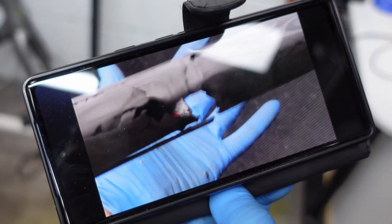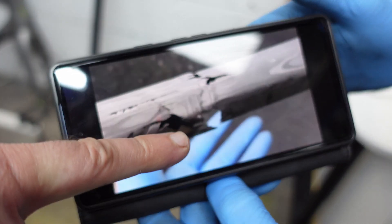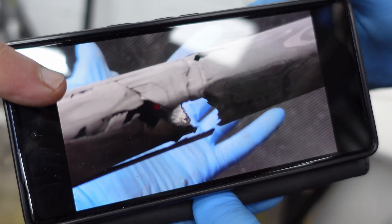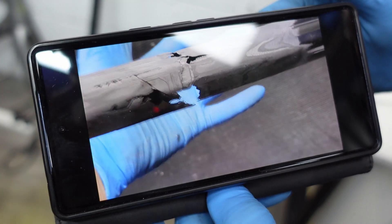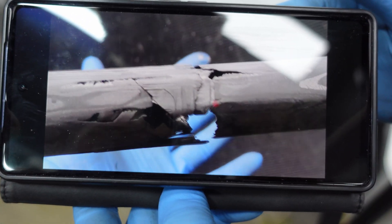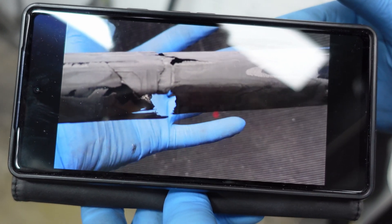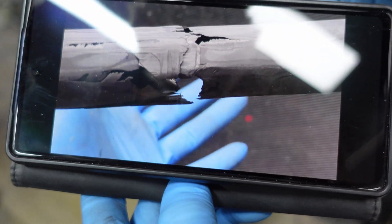So that's what it was before — there's a whole chunk missing. You can see how thin the material is; there's very little to be able to work with. The point is you don't want the carbon to collapse when you apply carbon to the surface because you change the characteristic of the tube. The tube has to flex in the way that the designers intended. We just have to follow what they had there and replicate it and replace it.